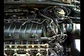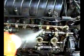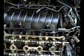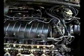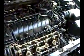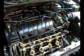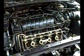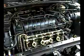I don't go through all that. I don't want to deal with that gas and smell it. So I just suspend the fuel rail. I disconnect the fuel injectors and I pull everything out, but I don't actually disconnect the system. I just suspend it. So to me that worked, even though the manual says to just go ahead and take everything off and disconnect it. I don't want to deal with that. So, more work, and I'll be back later with additional shots of the work I've done.